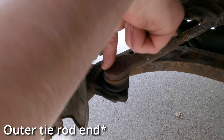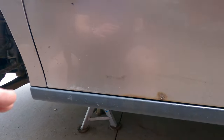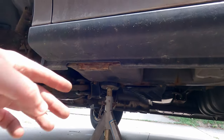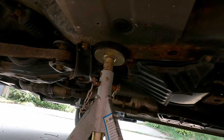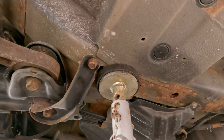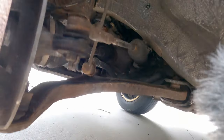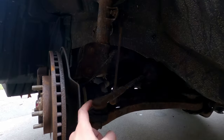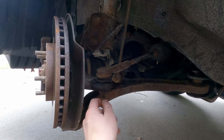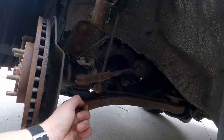So we're going to replace this little section — we'll show you how to do it. I jacked the car up using my floor jack, placed the jack stand on a real solid section, then turned the wheel all the way to the right to access this. We're gonna have to get a needle nose pliers on this cotter pin, or just manhandle it with fingers.